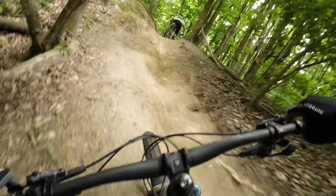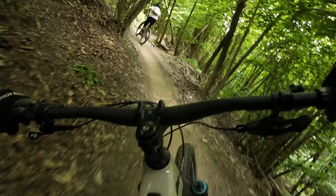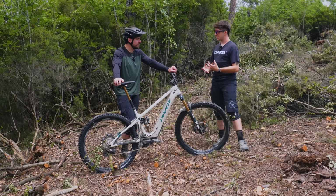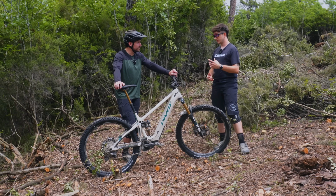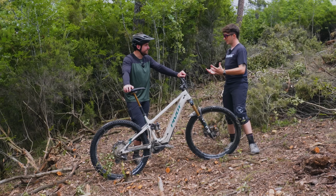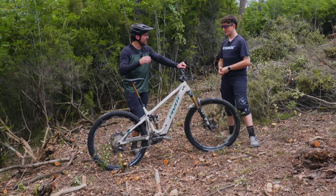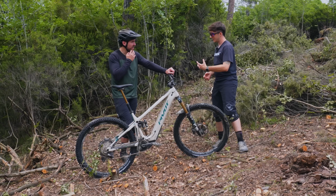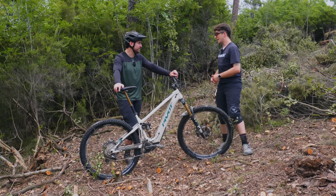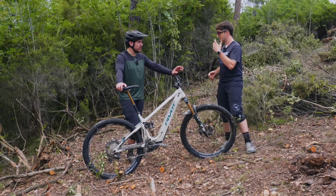Definitely, certainly not, no. Is there anyone who shouldn't be looking to add radial to their bike? Yeah, so there are some challenges with the casing. The first one is, at the same pressure, you have a 30% increased contact patch of the tire, which does sound like a lot. If you see it, it's pretty impressive. This also means there's more rubber on the ground, and that means more rolling resistance. Not exactly 30%, we're talking 10 to 15%, but that's something to consider.